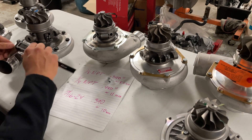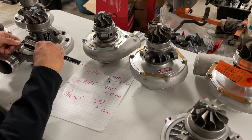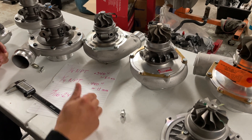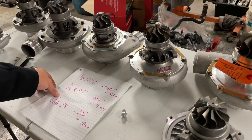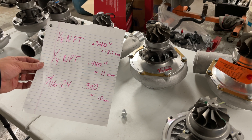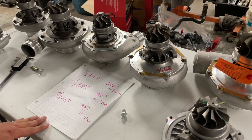Looking at the S300 here, I'm coming up with 0.440 to 0.442 inches, so we look at our sheet and 0.440 is going to be a quarter-inch MPT. Here's our little cheat sheet that shows the measurements and the corresponding fittings you're going to need to order. If you get confused, give us a call, shoot us an email, or comment below — we're here to help get you the right parts and get your turbo car back on the road.